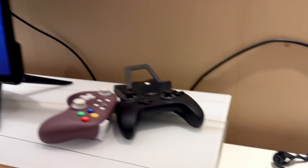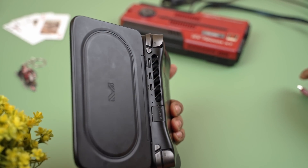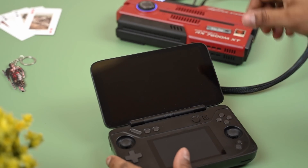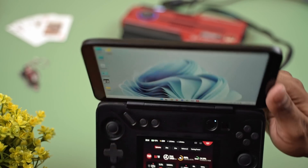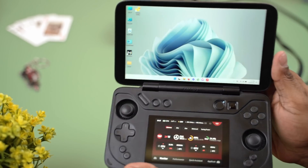USB 4 is the most convenient option — plug and play, like docking a Switch. Via one cable you connect to the eGPU, charge your device, and access the dock, internal SSD, USB port, and ethernet. With OcuLink, you cannot plug and play. You need to shut your device down, turn off the eGPU, connect the OcuLink cable, turn the eGPU on, then turn your device on. OcuLink only connects to the eGPU, so if you want dock access or charging, you still need a USB 4 cable. When both cables are connected, the device automatically chooses OcuLink.